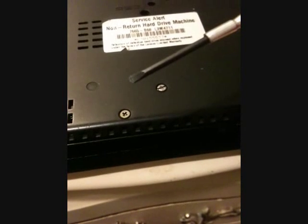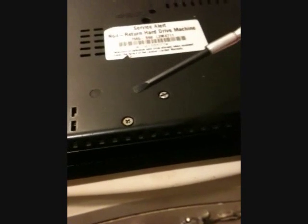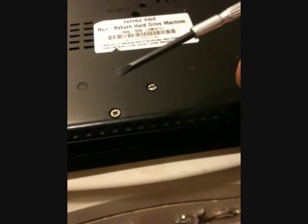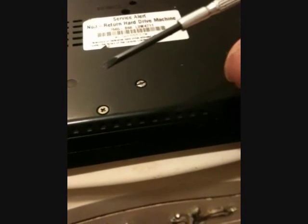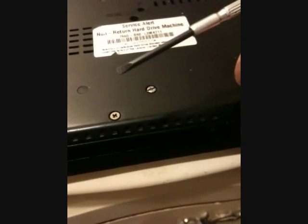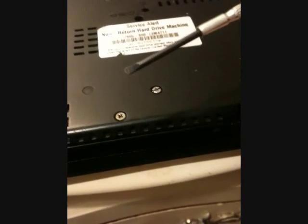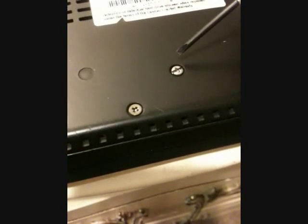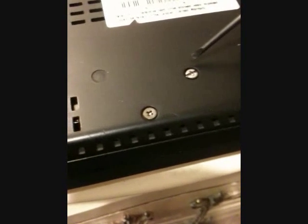The next technique I want to share with you may seem counterintuitive. I found out it's better to use a flathead screwdriver that fits perfectly snug on one of the cross sections of the Phillips screw head. That's because the flathead screwdriver is sharp enough to dig deeper into the slot and give it more bite compared to the Phillips. So this one is dual Phillips and flat, so no surprise here if I use a flathead.